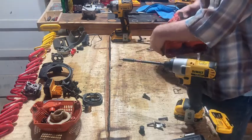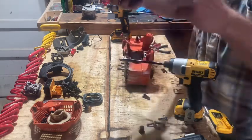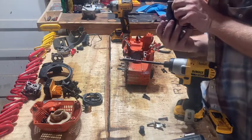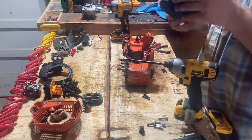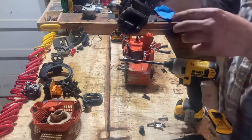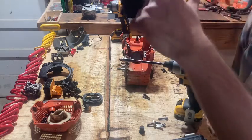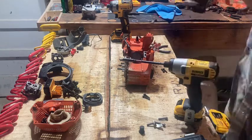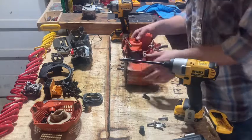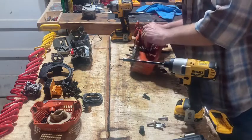Now this is a little tight at first. Of course, you've got your base gaskets here and all that kind of stuff. I didn't pull the plug out, but I'll get that. That's what I was talking about on my 440. That's kind of ramped. It sits like this. It's kind of ramped down, and I just opened it up. And then these I just brought back to flow, which in the port video or my grinding video, I'll show you that. So, unfortunately, to get this out of there, you do have to take the flywheel off. If not, she ain't coming out.